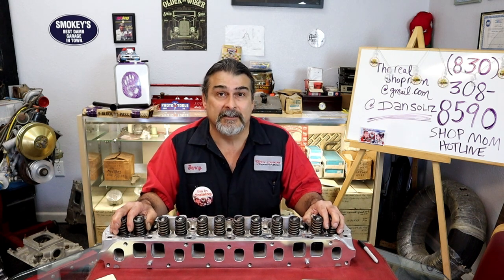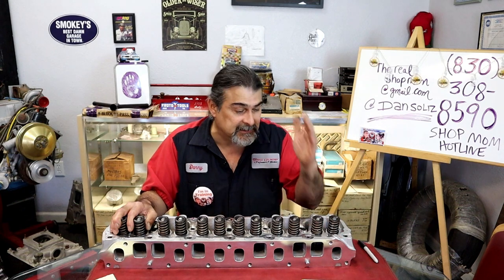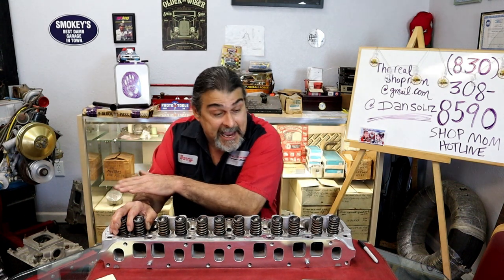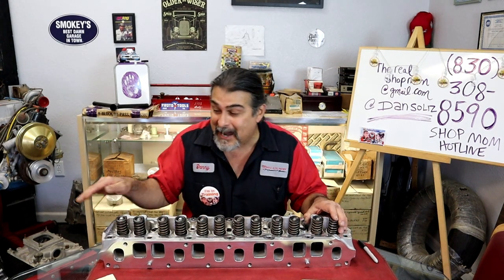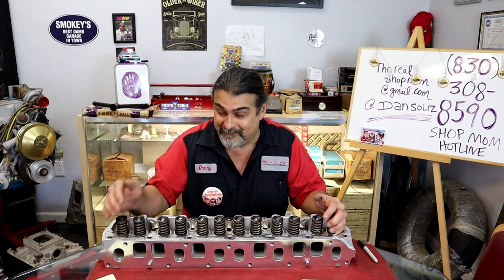Nothing is changed. Nothing is production. Everything is set to what clearance we want, what lifter preload we want. And guess what? Every valve has the same lifter preload. Every valve has the same heights. And I say within a thousandth, and I freak out if it's not less than that.